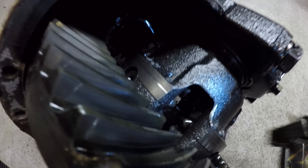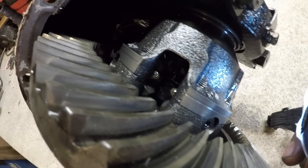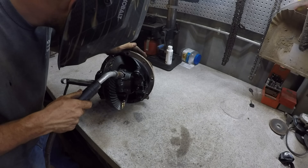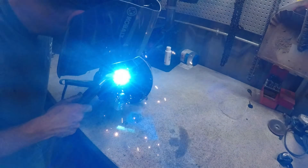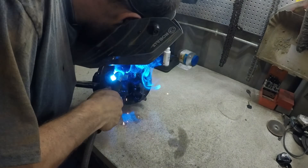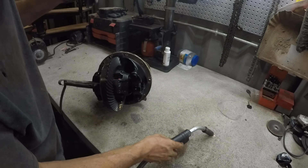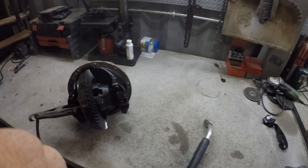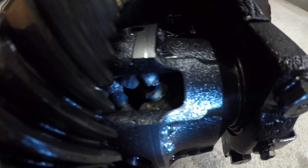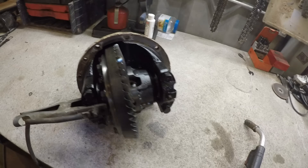This is what needs to be welded together — all those gears just get welded. There are pretty much four points, and then you can rotate this and weld it in every spot. It's a little hard to see in this one; some of them there's more space. But you can see all those gears are just welded to each other now, and it stops them from spinning. Just rotate it and do every spot in the axle that you can reach on those gears.